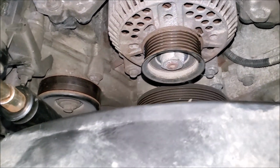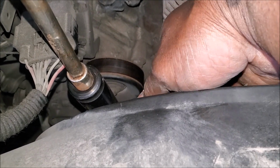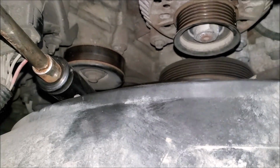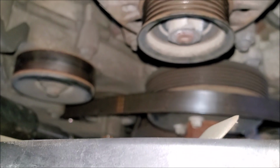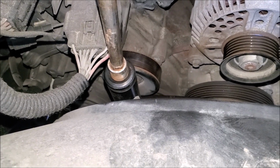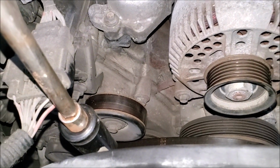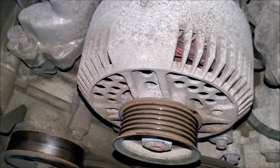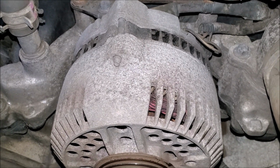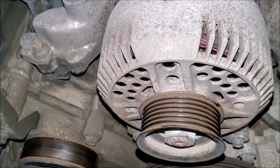Let me see, there are two bolts here and here, two down there that remove the alternator, as well as this one up top here, right here. I'll be able to get the alternator to move, and then disconnect the cable wires on top of it. So first I'm going to get these bolts removed. They look like 10mm sockets. Take those off.